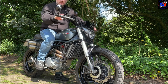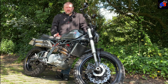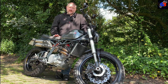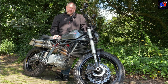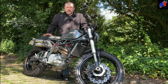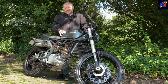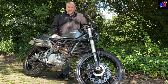I've got no issues with the riding position or the comfort - it's a really nice place to park your arse. One thing I've noticed with all the CCMs I've tried is the side stands are spring-loaded, so the moment the bike is up straight it just flicks straight up. You've got to be mindful of that when stopping and putting the stand down - if the bike isn't on its side with weight on the stand, it's just going to flick right back up. I'm absolutely roasting walking around the bike on another glorious day in the UK. Let's go for a ride - I'll tell you how this bike rides and make some comparisons to the bobber.